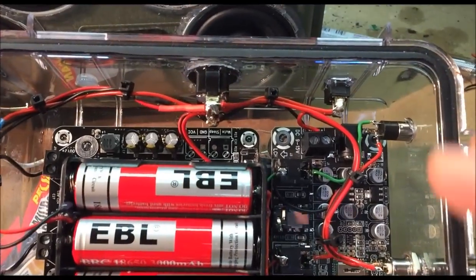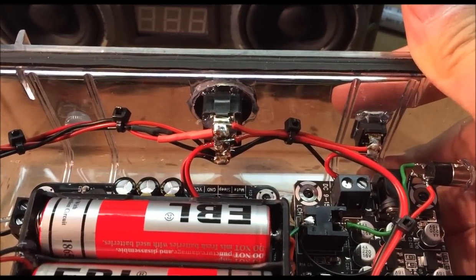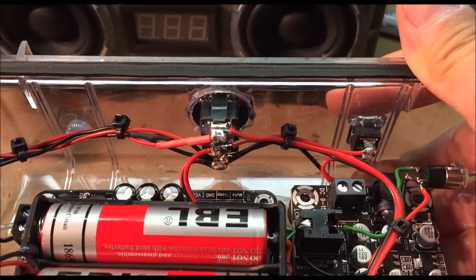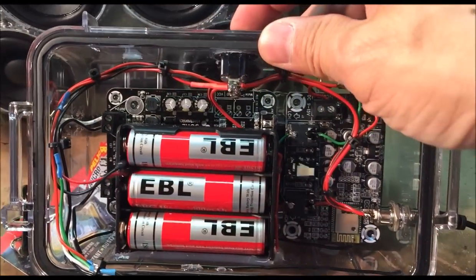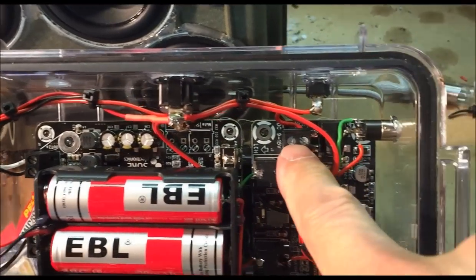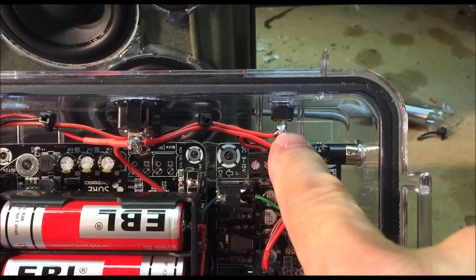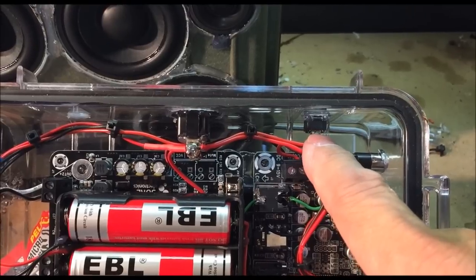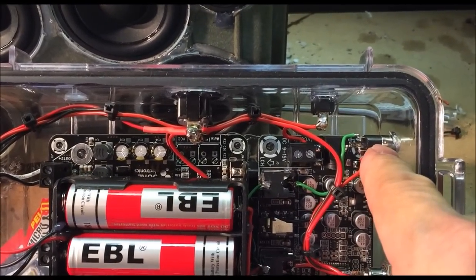Wiring this smaller box is very similar. It's basically a three-conductor plug — the bottom one has a bunch of black wires, which is ground; the top wire is 12 volts going in from the battery; and the one in the middle is switched — just like the bigger box. Once you turn it on, it supplies power to the middle and the light comes on. Ground goes to the Bluetooth receiver; the lug on the left is ground, the one on the right is 12 volts in. I also have a switch there — same strategy — so I have the option of turning on the master to power the amp, and separately choosing to power on the Bluetooth receiver or not, simply to save power and allow a wired connection to my music source.